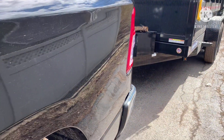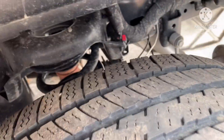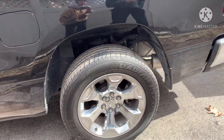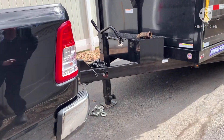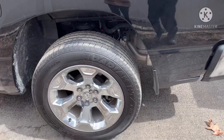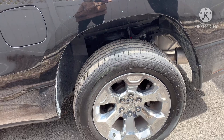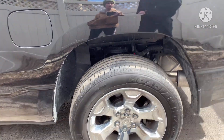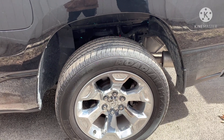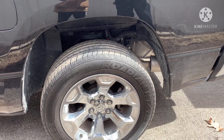It should prevent the truck from squatting. What we're going to do is take measurements of the truck as it sits at stock ride height unloaded, then drop the trailer onto the truck and measure the drop in the rear and lift in the front with the stock rubber stoppers. Then we'll install the timbrens and do a third measurement with the trailer loaded to compare the differences. Let's get a measurement on the stock ride height.